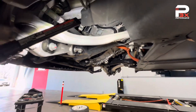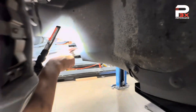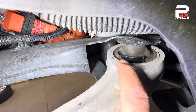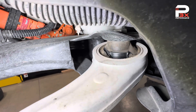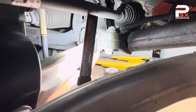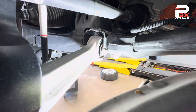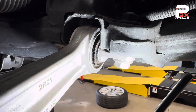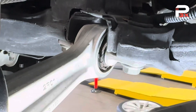As we look at the car, you'll see — peeking in here with my finger pointing — you can see this big tear in the inner bushings. So this compliance arm bushing is bad and will need to get replaced. For this forward arm, you can see how worn out it is. We'll also turn the wheel — that's a sure way of seeing if the bushing is bad. Go ahead and turn the wheel and we'll show that to you.